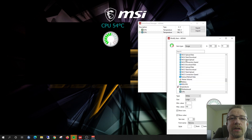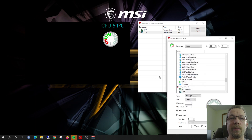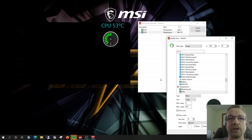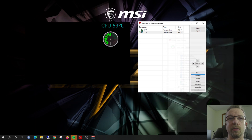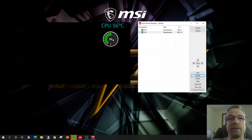If we click Modify, we can switch it to a large white reverse — which basically means it goes from the right as opposed to the left. Let's go to black because I think the black ones look a little bit slicker. We've got a minimum value of zero and a maximum value of a hundred; depending on your CPU's maximum temperature, you can put 105 in there — most Intel CPUs have 105 as their max. You can also toggle Show Icon and Show Value to decide whether you want those displayed, and you can increase the text size of the value as well.